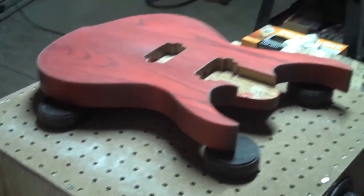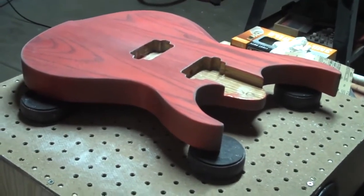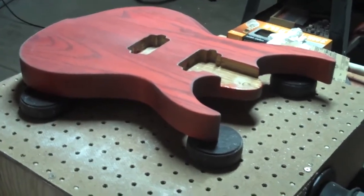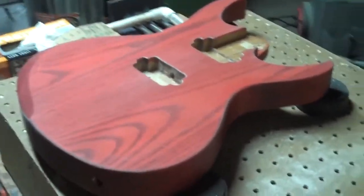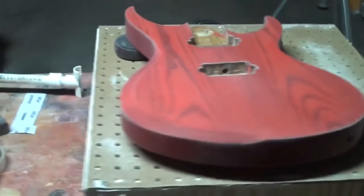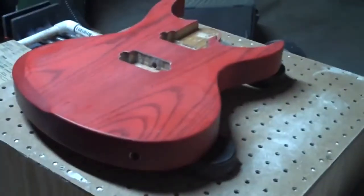But if you're going to do that by hand, I would recommend picking up a bottle of 3M's Finesse-It 2 rubbing compound, and that's what you would start with. That's your main scratch remover, and then switch over to something like Meguiar's plastic polish, and that'll give you the final high gloss shine. All right, we're done with all the polishing, so now we're ready to buff.